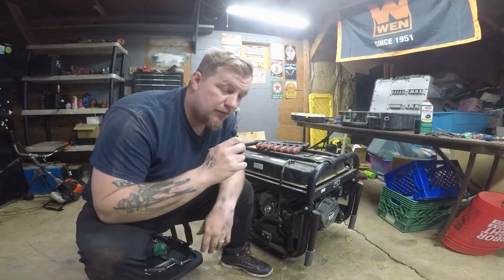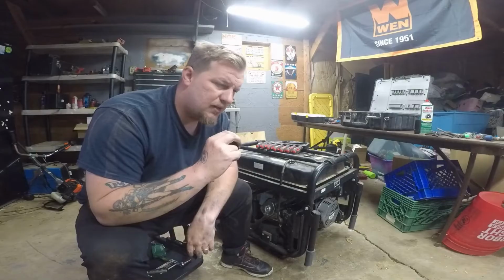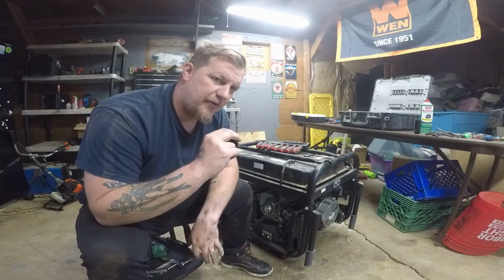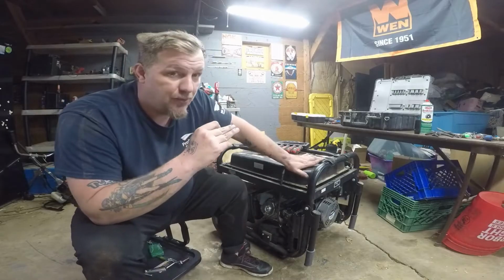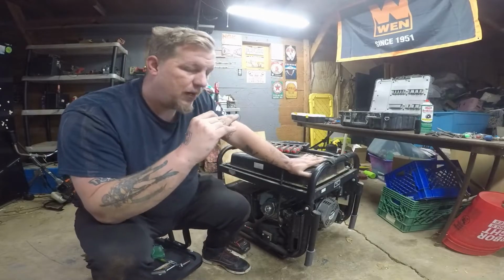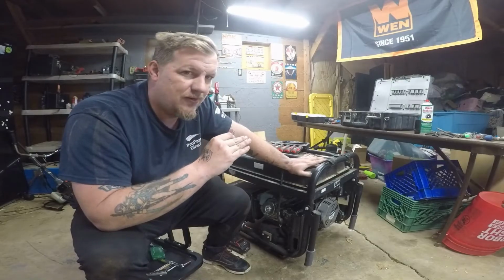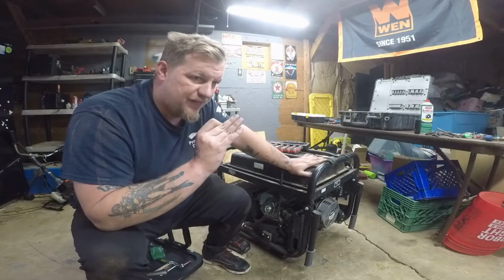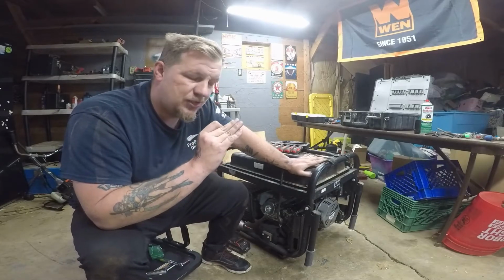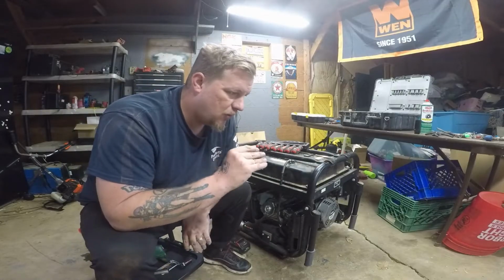We have a generator that was running fine and then automatically stopped running, and you can't start it again and it's backfiring. Well, that's what's going on with this one. You may not have this Pulsar generator, but I'm pretty sure if you have a backfire and your generator was fine before, this video is going to help you fix your generator. I'm going to show you guys how to adjust the valves, and this will apply to pretty much all generators